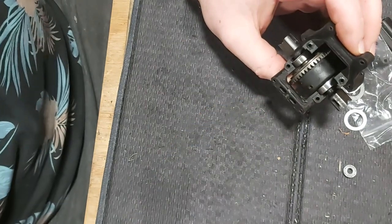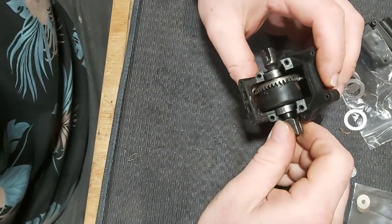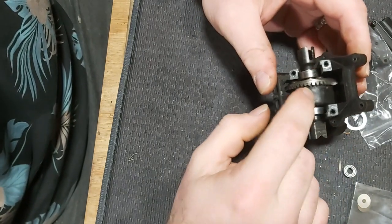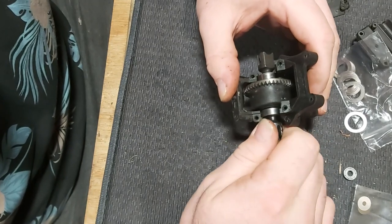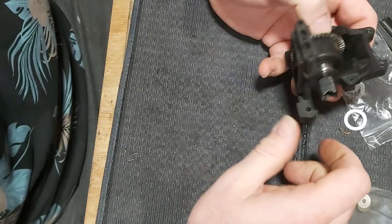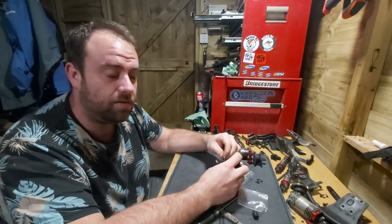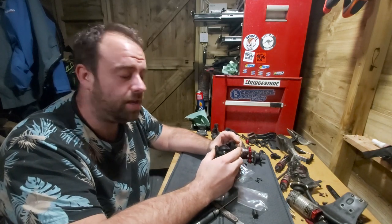Inside this diff I've put four extra shims — one on each gear. Some people put two, some put four; it depends on your gears inside. Don't just put what everybody else puts, because everybody's gears are slightly different. My Kraton has four in the front and four in the rear, but only two in the middle because that was a lot tighter. I'm really happy with how this is running. I'll bolt it all back together and get it into the Outcast. If you like the videos please hit subscribe. Coming up are the other parts for the Kraton build — please subscribe to the channel if you want to see them. Thank you very much and good night.